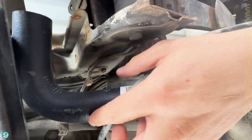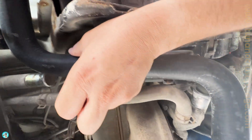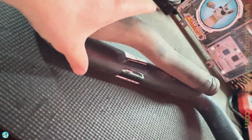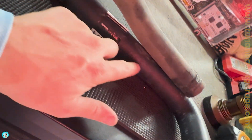Once this is cut to length, that's gonna fit perfect. So I've got the hose that's gonna have to work here and this is part number 22271 — it is a Gates hose. You can get this from pretty much any auto parts store. I've actually lined this up and it still appears to clear without rubbing onto anything, so let's get it cut and fit it again.